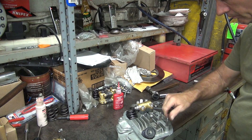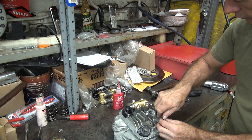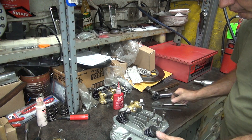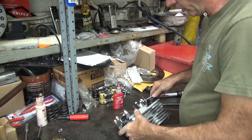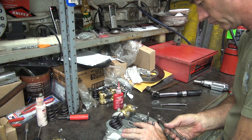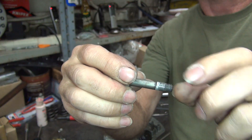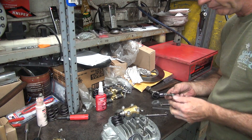This one's definitely stripped. I'm going to flip it and squeeze. It may be stripped, but it ain't loose — there are still threads in there. These up here are gone, but these down here are still biting. They're gone — so we've got to helicoil this. We'll be back.